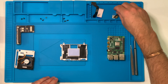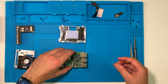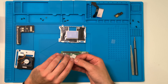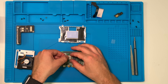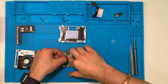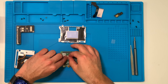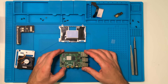Next we're also going to install the thermal pad for the Raspberry Pi itself. The Raspberry Pi thermal pad is much smaller and very thin — it's the small grey one. Take the protective coating off, then press it straight down onto the CPU, which is the silvery chip in the middle. You can leave the top coating on while you position it if that helps, then peel away the plastic film on the top.